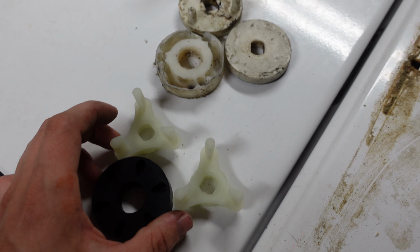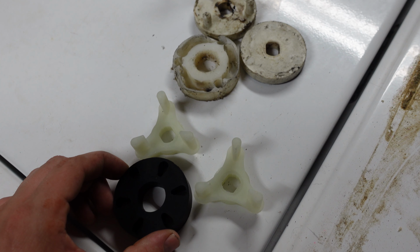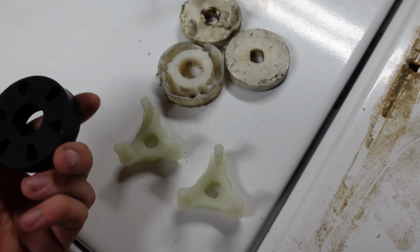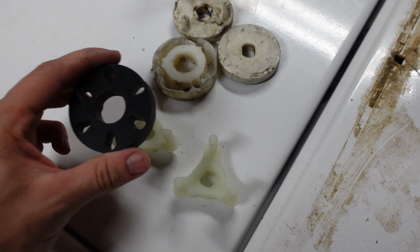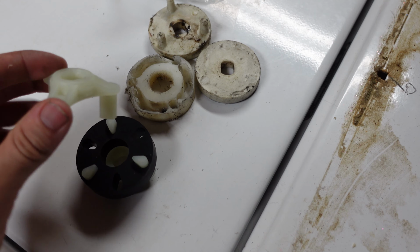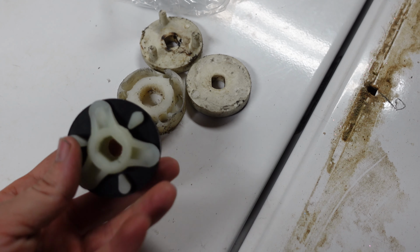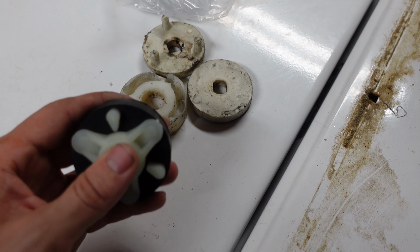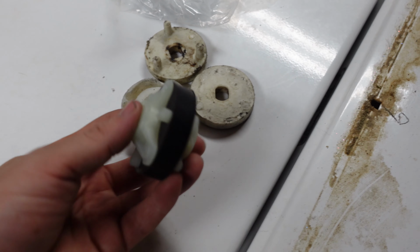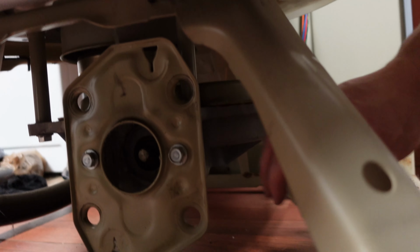These here are our replacement parts. I've kind of laid them out in the same way. This is ERP part number 285753 drive replacement. You can see it's sort of a revised part. This is from their newer washers, I believe, but it fits together in much the same way. You can see how it transmits torque through those splines, and it provides that sort of physical fuse for the whole system. So step 1, I guess, is just going to be sticking the coupler in here somehow.